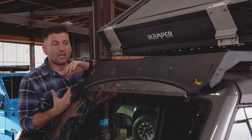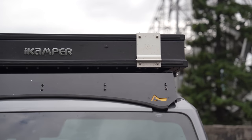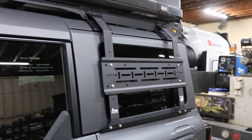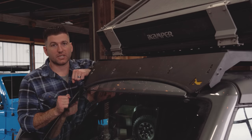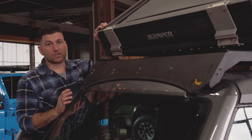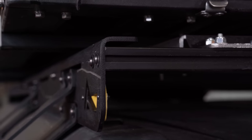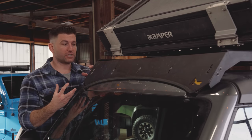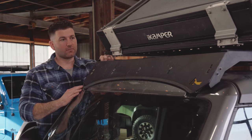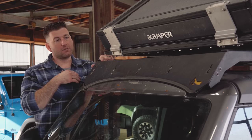One of the most commonly asked questions I get is what roof rack do I use. I use the Trail Racks Tremor Rack — it is hands down the best on the market. This has the highest weight capacity of all the Bronco racks at 300 pounds dynamic and 850 pounds static. You have to use the rack packs to get that weight; if it's just a roof rack, you still see the limitations of the Bronco roof, which is 100 pounds of dynamic weight. Another thing I really like about this rack is on the side rails it has a 90-degree bend — that's not something I've seen on any other rack. It drastically improves the structural rigidity of the side rails with no flexing at all, and it's also slotted so you can run different accessories up there. This is a relatively low-profile rack given all it does, and you can still remove all the roof panels with it.